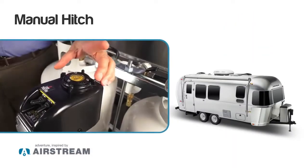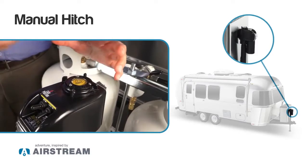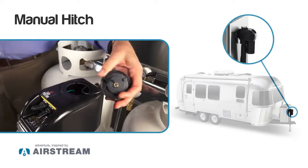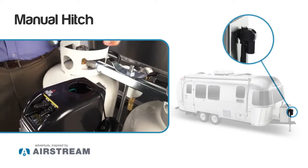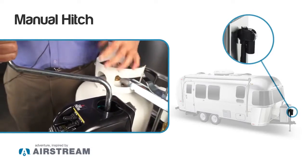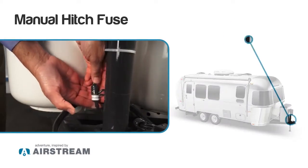Next we want to discuss what would happen if you didn't have any electric power and you couldn't get the trailer off your tow vehicle. You can actually remove the little bubble level. It screws off. Take that off, and then every trailer comes with a manual crank handle, and you can insert that down over a little square inside there, and then you can raise and lower the jack with this manual handle.